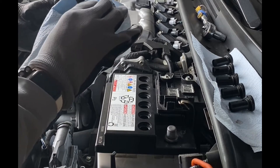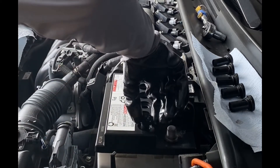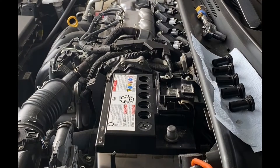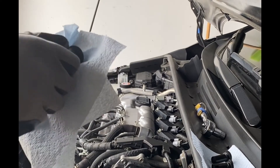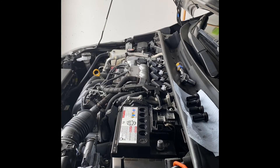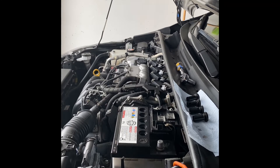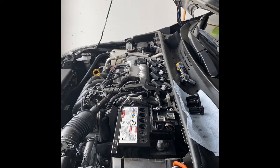The next step is to clean off each one of your battery electrolyte screws, just to make sure you're not putting any more debris into the area. After removing any debris, go ahead and screw them back into the battery. Here's a view of what one of the screws looked like before I cleaned them. Make sure when you're replacing the screws you don't screw them in too tight — we know you've been at the gym, but now isn't your time to shine.